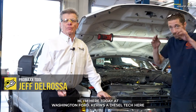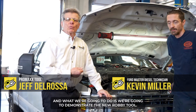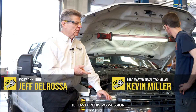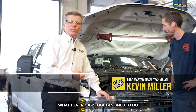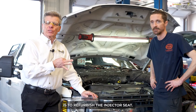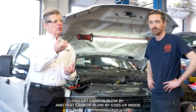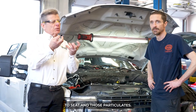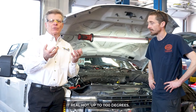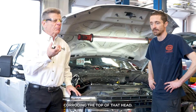I'm here today with Washington Ford. Kevin's the Diesel Tech here and what we're going to do is demonstrate the new Ravi tool — he has it in his possession. What the Ravi tool is designed to do is to refurbish the injector seat. The problem is that when the injector seats are sitting in the truck, you get carbon blow-by, and that carbon blow-by goes up inside the seat with particulates that are real hot — up to 1100 degrees. They settle in on the head and can burn a divot, corroding the top of that head.